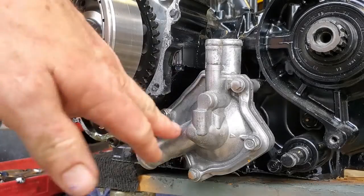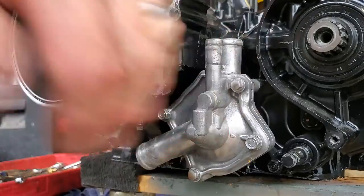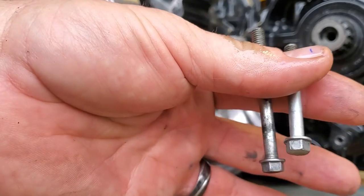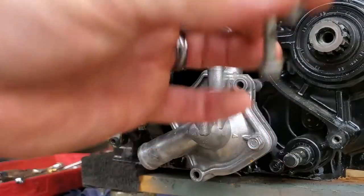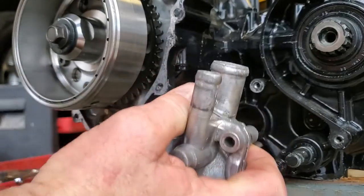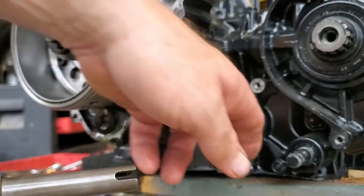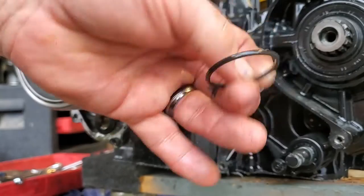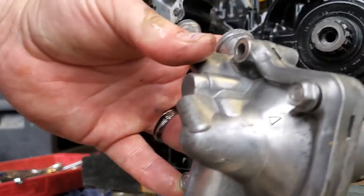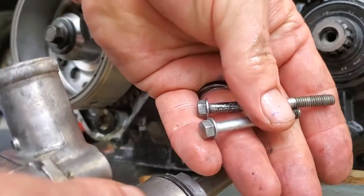I've turned the engine around again. We're going to go ahead and pull the water pump off — these two bolts are holding the water pump halves together, but these two eight millimeter bolts are holding the water pump to the engine, so we're just going to undo those. They're different lengths, so keep track of which one goes where — the longer one went to the bottom, the shorter one went to the top. Then this water pump just pulls out. If you look on the back there's a notched piece here and there's a notch on the crankshaft back there. By the way, don't lose this o-ring — otherwise you'll have an oil leak down there too. I know this water pump is good so I don't need to take it apart. I'll package this with the two bolts and move on.